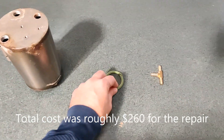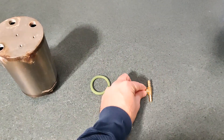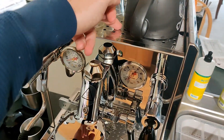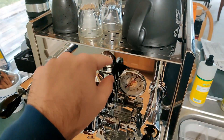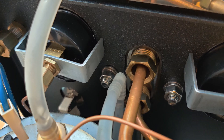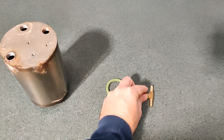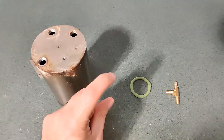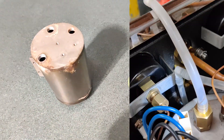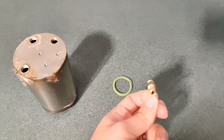The parts I replaced overall: the insulation, a new gasket, and a brass T-barb connector. Just behind the machine here is where that connector is located — you have a silicone tube coming out of the steam boiler, another tube coming out of the back of the brew boiler, going into that connector and draining out the bottom. Here's a picture on the inside of the machine highlighting that part — or lack thereof. The original one is plastic, and with the heat of the steam boiler being quite high over time, that plastic basically disintegrated.